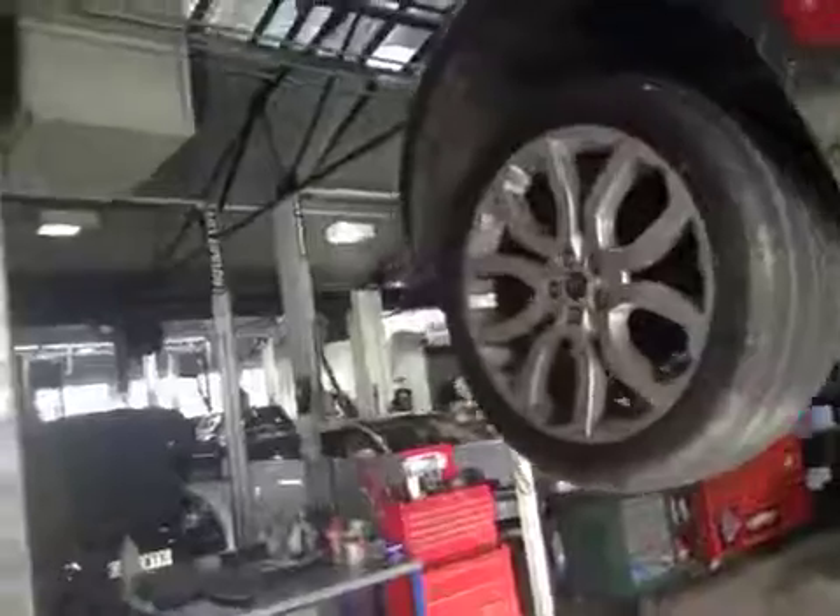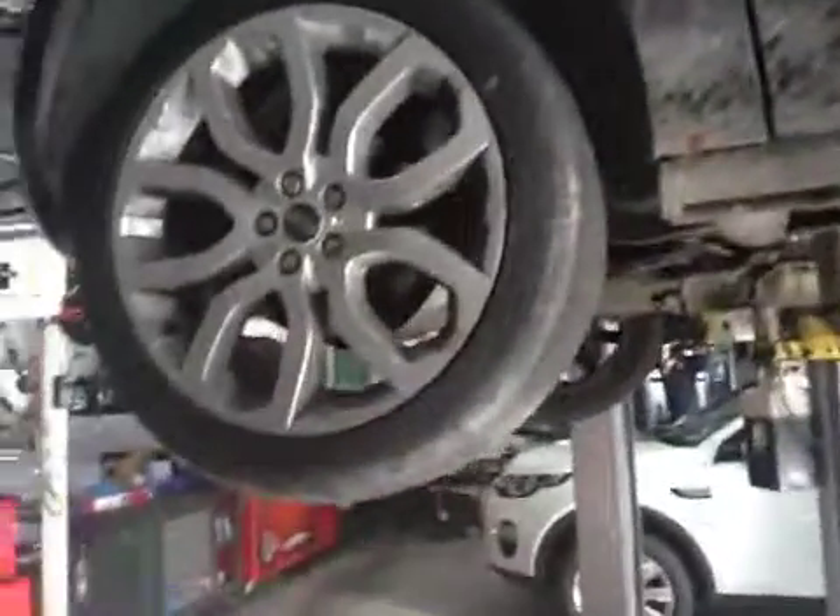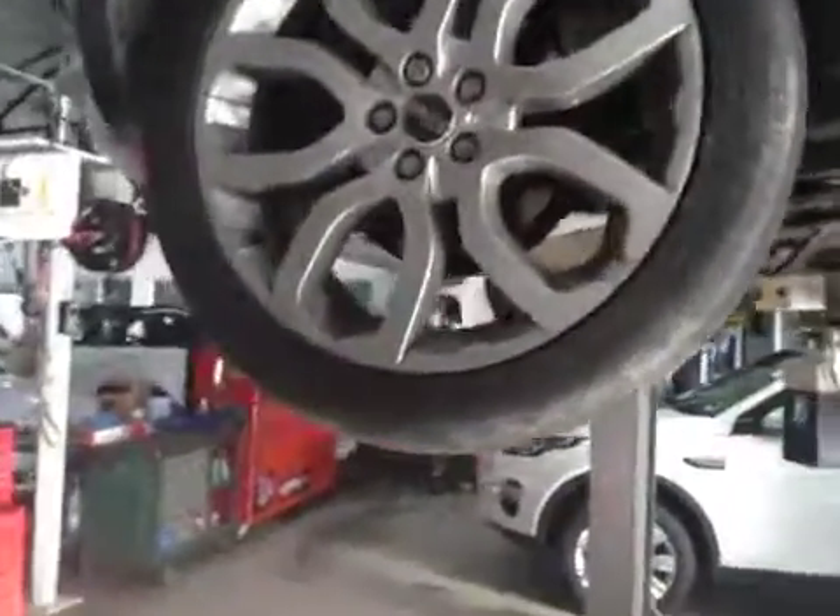All trims and mouldings down this side are in good condition. Coming to your nearside front tyre — the tyre is in green, front discs are in green, and front pads are in green. All suspension components on the front of the vehicle are in good order with no play at the front wheels. All gaiters are free of any splits, calipers are in good condition, and brake lines are all free of any damage. The engine and gearbox are free of any visible oil leaks.